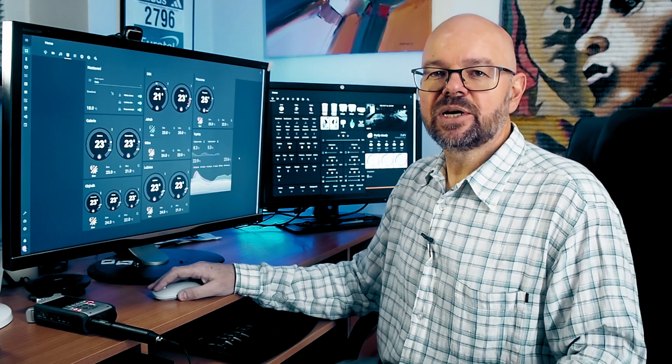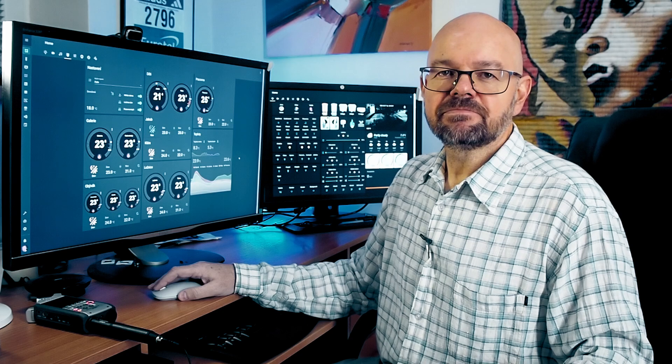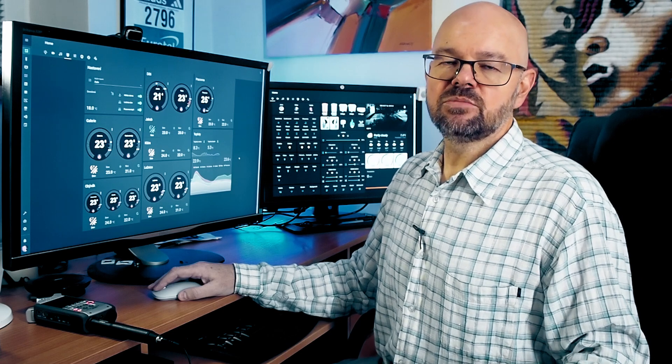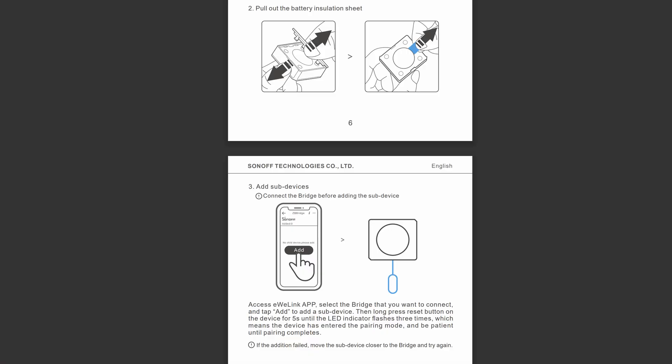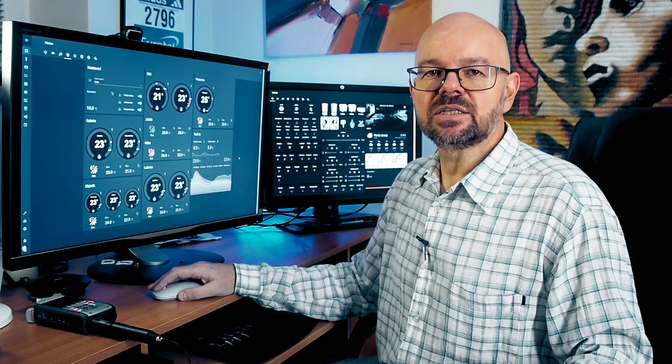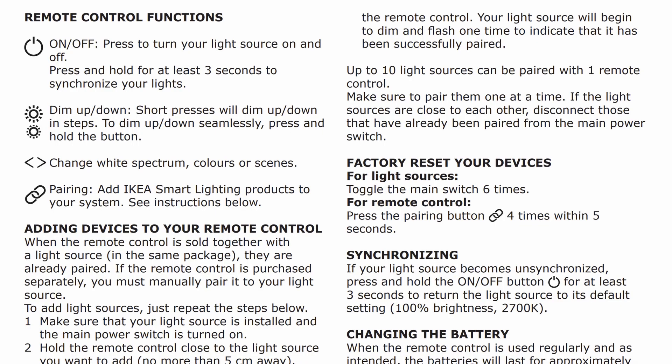Now that I've spent half this video on non-related topics, let's go back to ZigBee. I plugged the controller and installed ZigBee Home Automation — ZHA — and now I can start adding devices. Check the instructions for each device on how to enter inclusion mode. Some devices have a hidden button you push with a pin for about five seconds, like adding a SIM card to a phone. These are typically battery-powered devices. Smart bulbs usually need to be turned on and off repeatedly, like five times in five seconds.